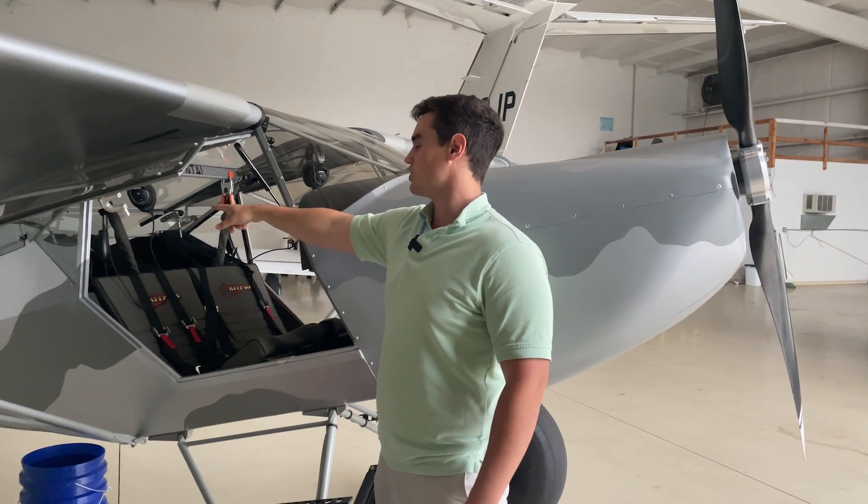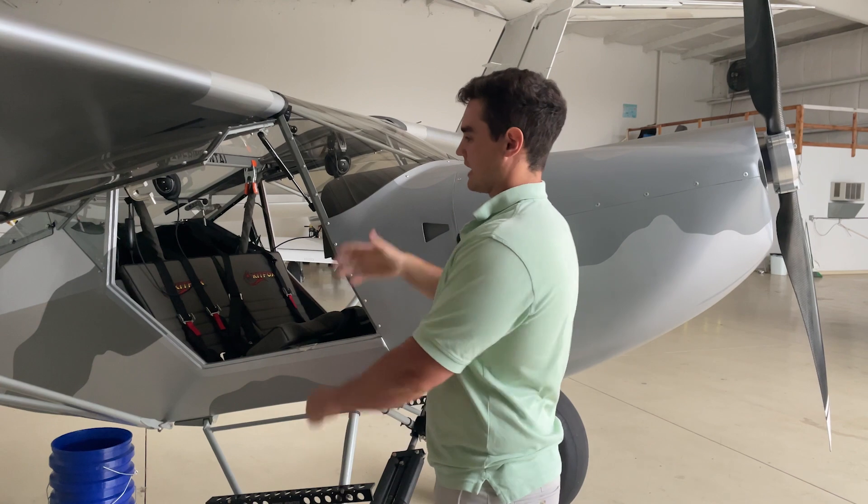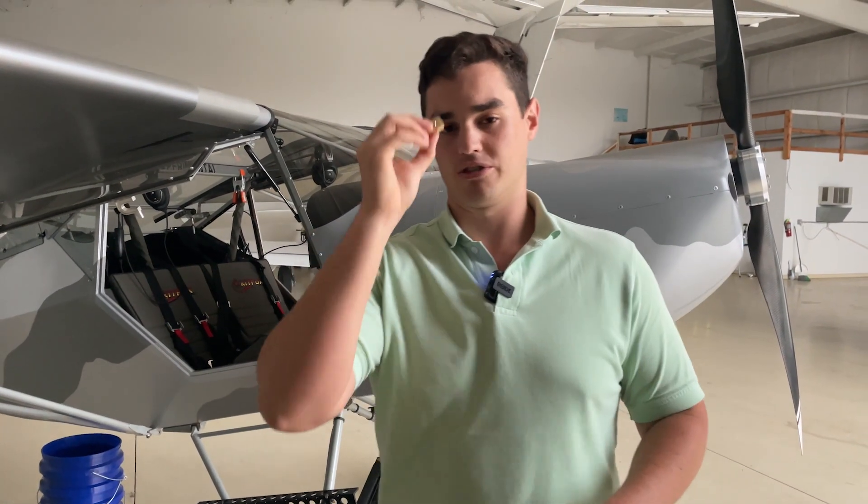After draining the fuel out of the wings, I have to take these covers off, pull the pins out for the wings, detach the flaperon hinge joints, and then get the top cover for the tail — then it'll fold all the way back and we should be good to go. That's the general process. We won't start the timer yet — first I'm going to replace this part here. Okay, this is going to be a mess.